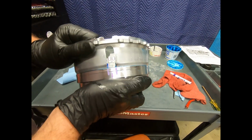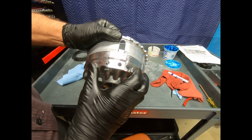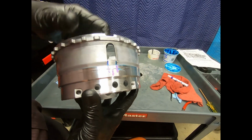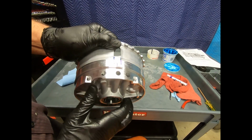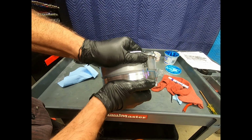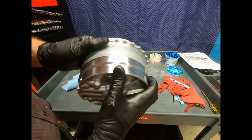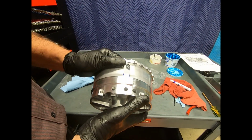Now, this can actually be moved. It takes a little bit of force. In fact, if you can tell, I did move it a little. But what happens is that this is going to index with the lugs in the case, and I want to make sure that my bolts line up. And by the way, when you put this together and you load it in the case, go ahead and check this and put your bolts back right away. Because if they're slightly off and you're not able to put it, just pull it out, and you can actually grab it with your hands and turn it if you have to, even after you've put this together. So you can do it. And of course, obviously, if it's at 180 degrees out of position, well, that's going to be kind of hard. You might want to go ahead and take loose the snap ring.